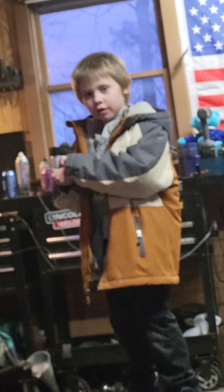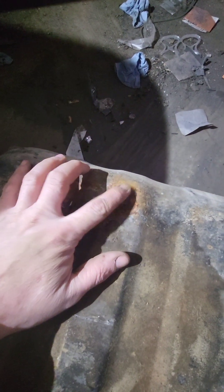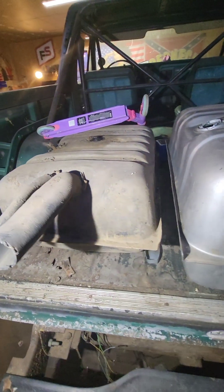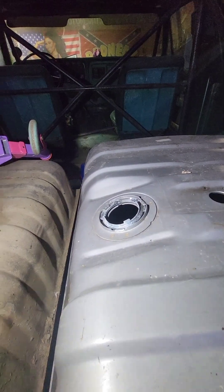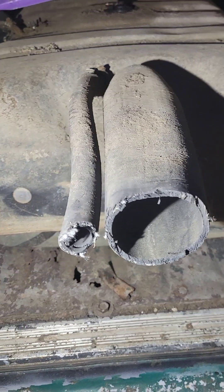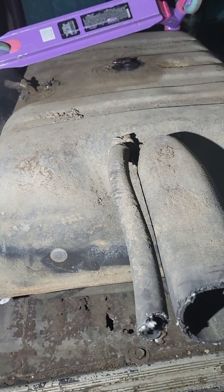Tonight for help I've got Charlie, right now he's eating his candy. Let's get the fuel tank dragged out. Right there is where the fuel tank rusted through. Here's the original fuel tank — I think it's 25.3 or 25.2 gallons. The replacement tank is either 33 or 35, so I need to order the fuel sending unit, a new vent, the fuel filler hose, and vent hose — that'll just be a chunk of hose cut to size.